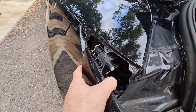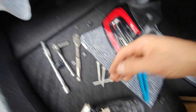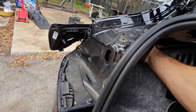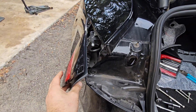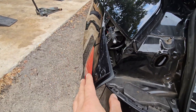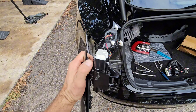You have to unbolt these, then go ahead and pull the whole housing as far as you possibly can to get this door out. I'm going to need two hands to actually get it out. You have to feed this rubber block through — there we go. Now I need my two hands: one to pull away the charging cables and piping here, to get this door to slide out just like this. Our old door and motor lead are now removed.